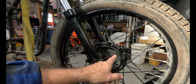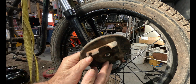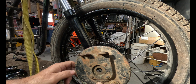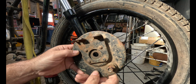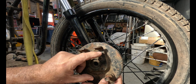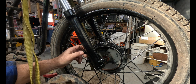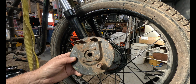Obviously I haven't got the backing plate in, and this is the backing plate. On a normal band it locates in against the fork leg, which is steel. But you don't want to have something localised on an alloy fork leg. They've got the two original caliper mounts for the disc brake, so what I will do is actually take this plate off — grind the rivets off, punch it out, fit it up. And I'll have to make another plate that will locate in on the lugs here. What I'm envisaging is machining up a couple of stubs with a thread in them and then welding those to a plate that I'll rivet back onto here.